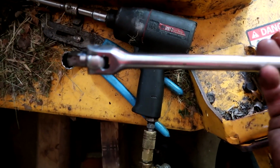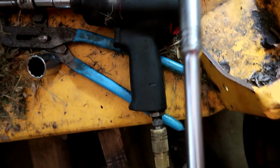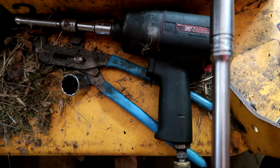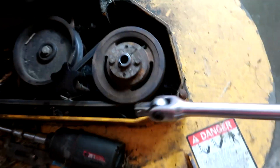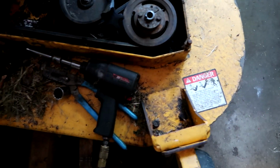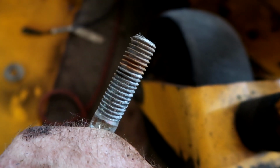But you're asking, well, how did I do it? So I went ahead and hooked up this little tiny snap-on breaker bar. This 1/2 inch impact with a pretty big compressor upstairs couldn't pull that off. I hooked up this breaker bar, and again I had the block under there, and sure enough, with a few tugs it broke the bolt. And if you notice, the threads are coarse, so once I broke that initial bind, it just came right off.